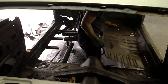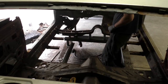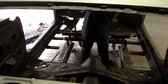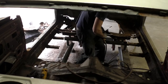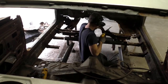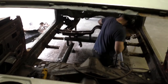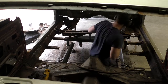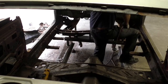I skipped ahead and I didn't show you in the video, but I removed the torsion bar support frame rail, working from the edge over. It's easier to be able to access the torsion bar when we go to cut that off — easier to drill out the spot welds in there. Even if I am removing a frame section, I'll remove the stuff on top of it just so I can access it and verify more measurements. This took about 10 minutes to remove this part of the floor pan. Looking at the torsion bar support, there's nothing there in the right-hand corner. I'm surprised this car was still staying up. I did take a bunch of measurements from our level frame jig and everything looks like it was set in place — the floor pan was the primary thing holding this car together.